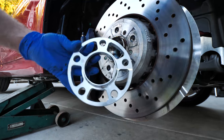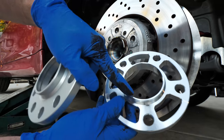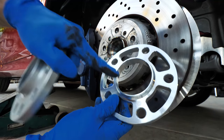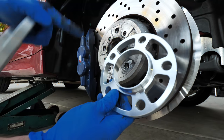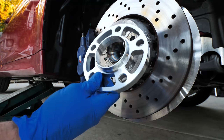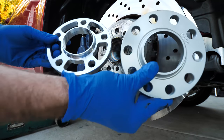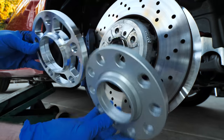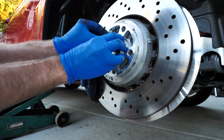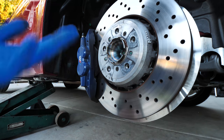Now with spacers, remember they are not made equally. These are both motorsport hardware spacers and they are both hub centric, which is very important. Never use a spacer that is not hub centric — you can have wobbly wheels and it is not safe. With the studs and these spacers it is perfectly safe. These are the track light option, which are a heck of a lot lighter but still the same 15 millimeter. Let's go ahead and install the studs.